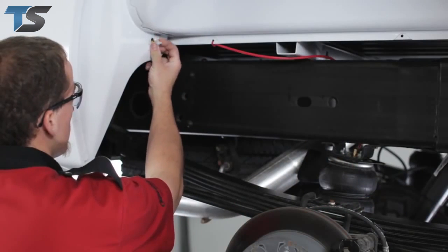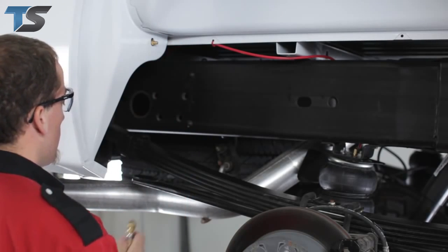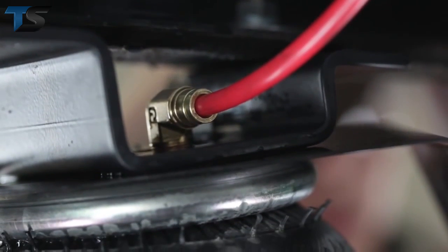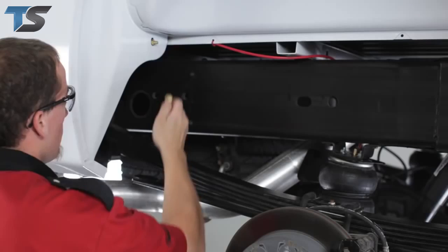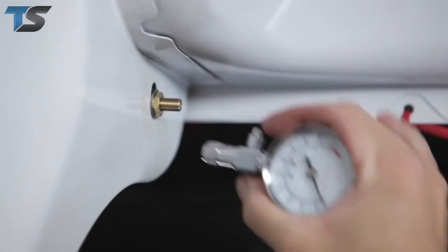Install the airline tubing for the second spring following the same steps. Now it's time to inflate your air springs. We recommend that you inflate the air springs to at least 50 pounds per square inch. When inflating your air springs, add air pressure in small increments. The air spring inflates much faster than a tire since it requires much less air, so you'll want to check pressures frequently during inflation.